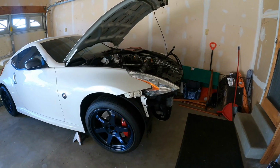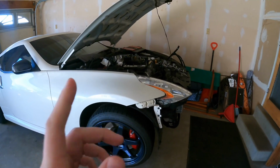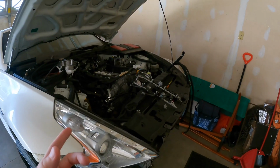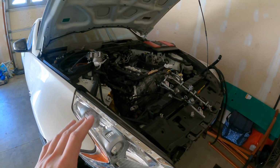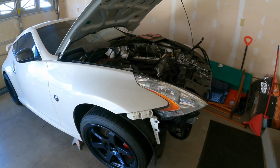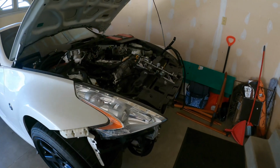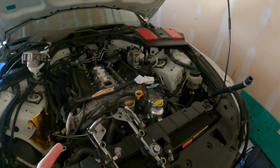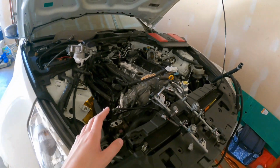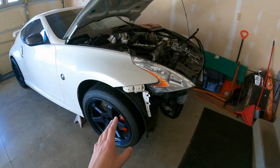So for those of you that are not familiar with the old setup on this, it was a stock motor car up until what we're doing now. Completely stock, open motor. It's got like 20,000 miles on it. The previous setup was a single turbo, which is what we're still gonna be doing again, but it had a Garrett 6465 turbo and AUS 1400cc injectors. I did just raffle off the turbo kit, so that's why nothing's in here right now. So that's what we ran previously.